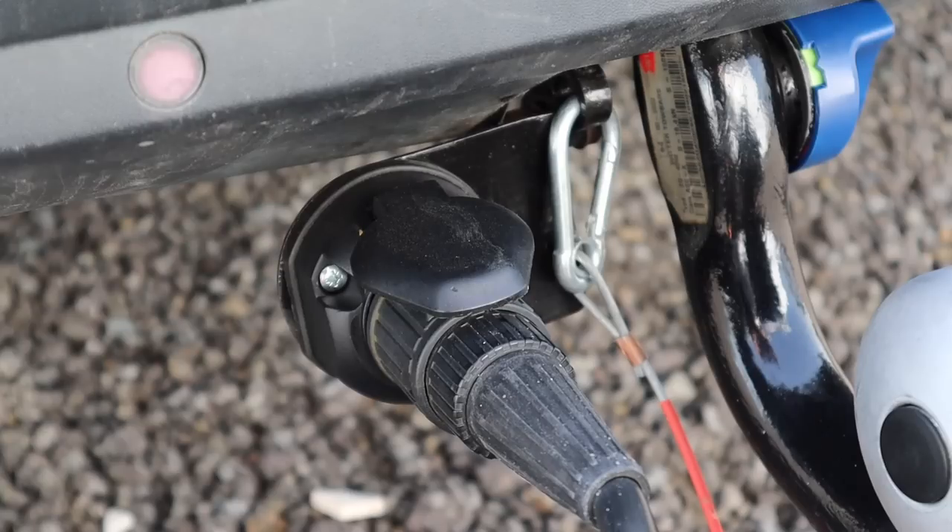So actually what we need to do is have a comprehensive way of performing a lights check between two people, making sure that what I'm doing at the front of the car is what Angela is seeing at the back of the caravan. Having two people makes this infinitely easier, however it's not impossible if you're doing it by yourself. If you are doing it with two people, have a clear line of communication — either use your phone, walkie-talkie, hand signals — however you do it, have a clear line of communication that you both fully understand. Have one person sat in the car and the other person at the back of the caravan. Make sure that nobody is standing directly behind the caravan, and make sure you can see the other person clearly in your mirrors.